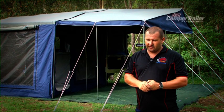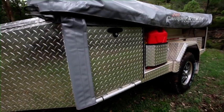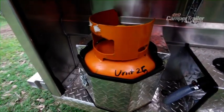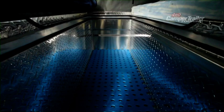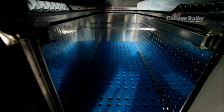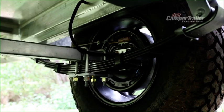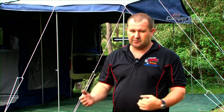On top of that, we have an aluminium tub. It's bolted and bonded with a Matrix FC. The Matrix FC doesn't only bond it — it actually insulates the two materials so there's no electrolysis. You don't want to overspring your trailer because it will end up like a kangaroo. We get to know what sort of gear you're going to put in your trailer, so we spring it accordingly.